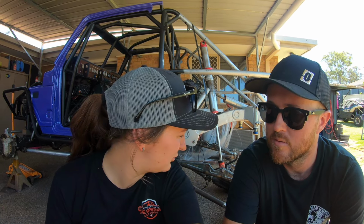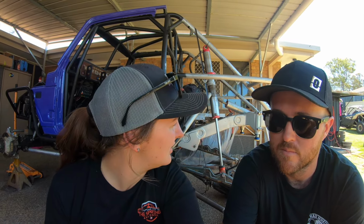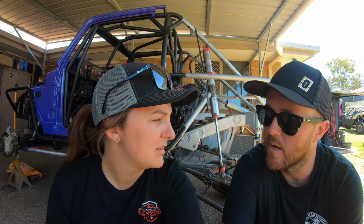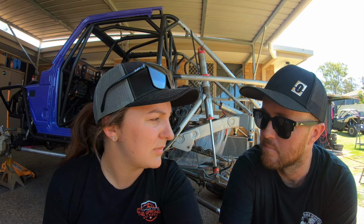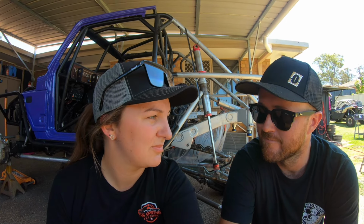Ended up with about 24 inches of travel, which is a lot of up travel gain, which is what this car needed. So, huge improvement. Now we're going to work on the shock mounts and looking at a truss. Work out a bit of a truss idea, and how we're going to incorporate bump pads into that. Do a bit of drawing and keep on going.